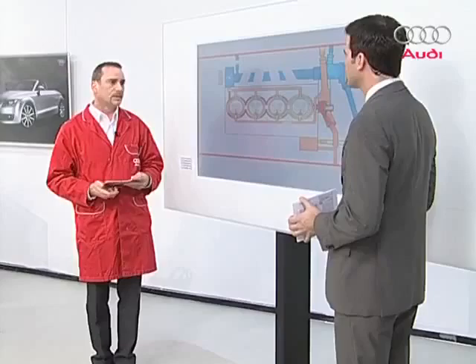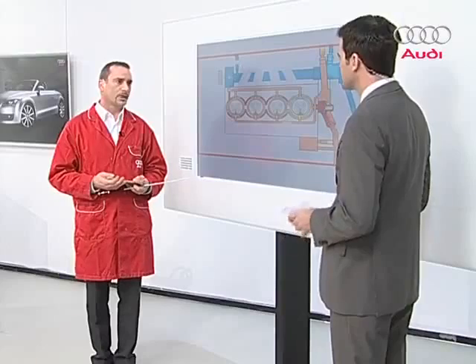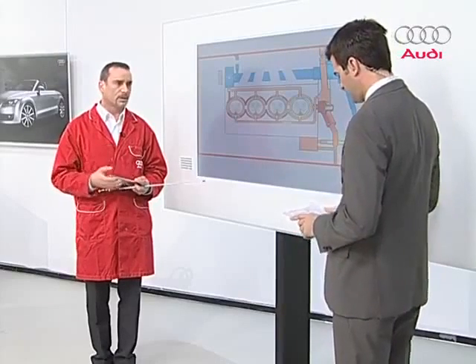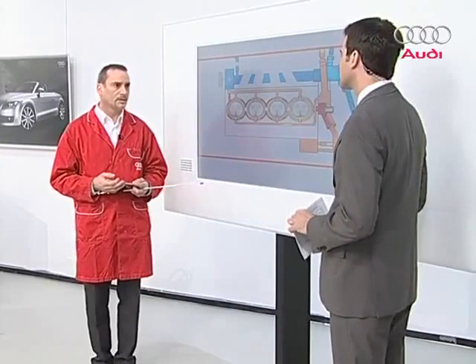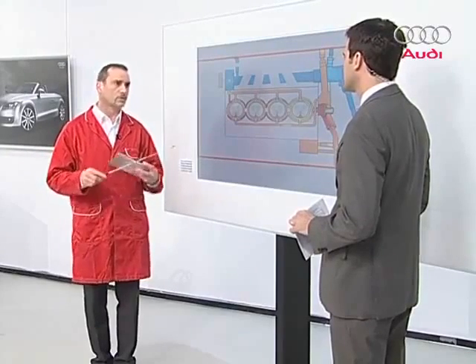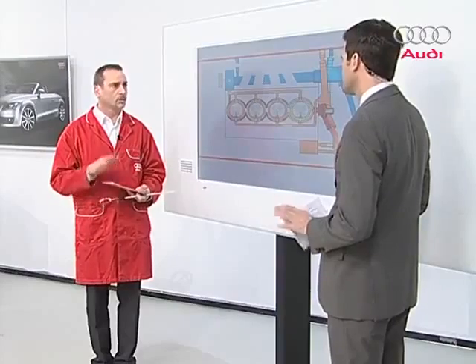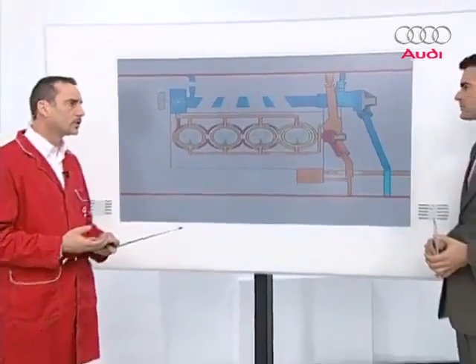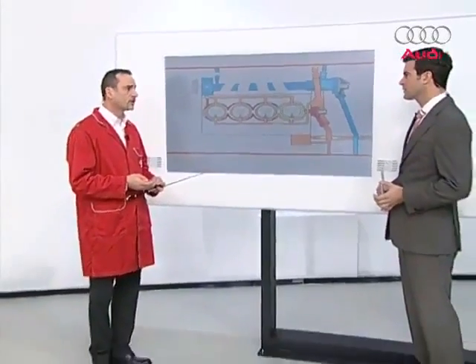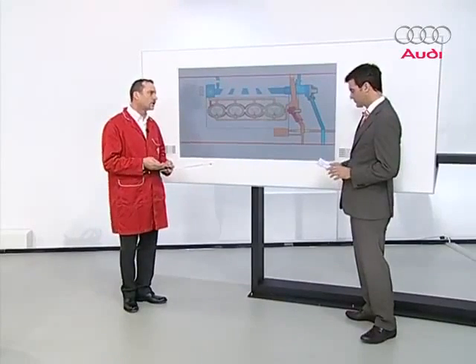The restrictors are necessary because we essentially have two separate cooling circuits, and these circuits should not be linked to one another. From a customer service standpoint there is only one coolant expansion tank, but because the circuits have different temperatures and pressures, we want to keep coolants with varying temperatures and pressures from mixing — that's what the restrictors and non-return valves are for. This does make it a bit tricky to completely fill the entire cooling system, since the restrictors cause a bottleneck.